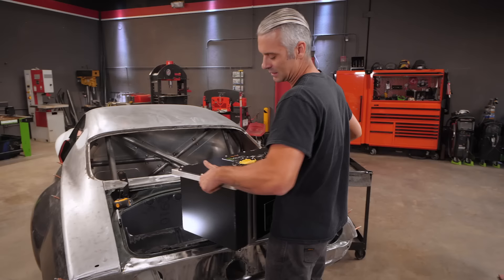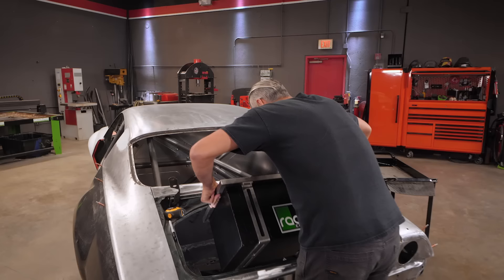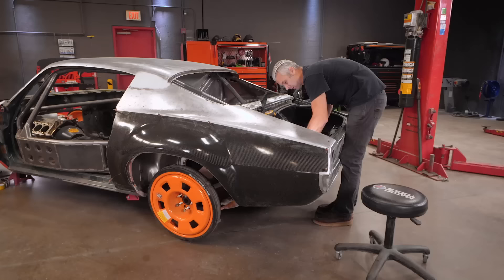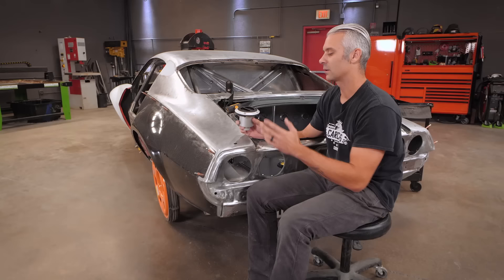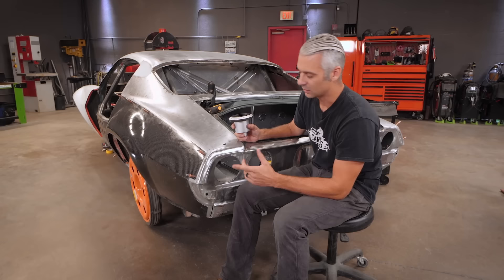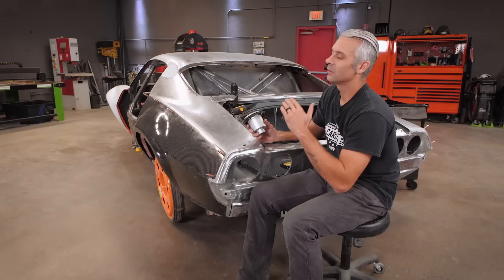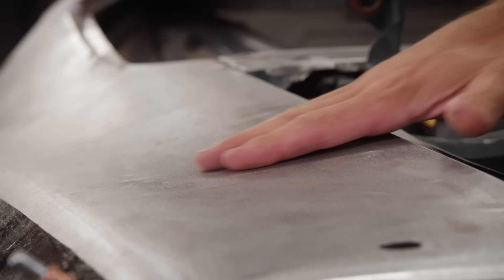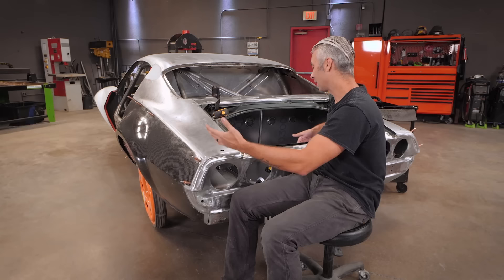Jimmy's got the carbon quarters installed on the Camaro, and we did strip off all of the paint to give us a nice clean surface to work with. Now, since we're in the back, we're going to continue on with our fuel system. We already have a hole cut in the trunk for our Radium fuel cell, and we just have to work on getting the fuel into it. Radium also sent us what we need to hook up a fuel neck to the fuel cell — a little 45-degree fitting that goes on top of the cell, and a really cool sleek fuel neck. Two things to consider when looking for a location to mount the fuel neck: the drop or angle of the tube as it goes into the fuel cell, and the second one is location. We're going to mount ours up here on the quarter, and on the back side of this filler neck is a little foam pad — the best part is you can mount it on a little bit of a curve, which works great because our quarter has a slight curve here, so this should seal everything up.